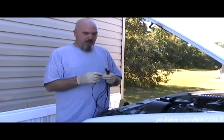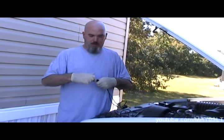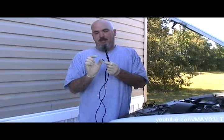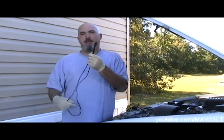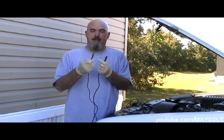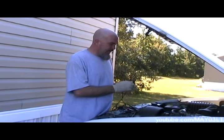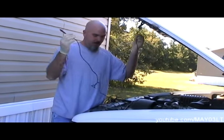I fabbed up this little jumper lead from two old multimeter leads. I can configure it however I want — if I want two probes I can just unscrew the alligator leads. Usually what happens is the little banana plug from just the wire flexing will break off, so I took two of them and spliced them together to make my jumper lead. I just took a generic alligator clip and attached it to the other end so I can use it to put ground to something. I didn't say power, because this is unfused — you won't catch me hooking it up to the positive battery terminal, because if I accidentally touched something those sparks are going to fly with no fuse in the circuit.